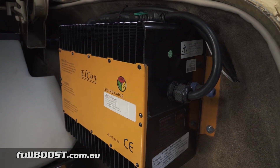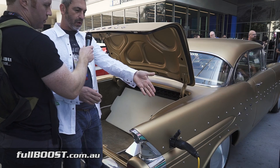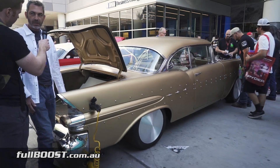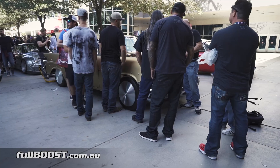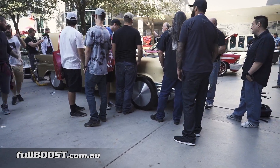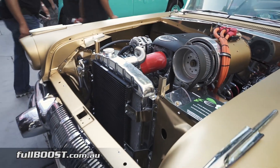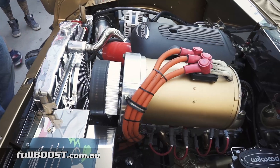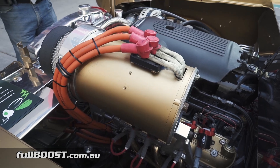This is basically just an inverter and charge system. It allows you to use your industry-standard J1772 charge station port, or you can just plug it into 110 or 240 — it doesn't care how you want to charge it. Most people would charge it overnight at home. Most people don't drive over 80 miles a day, so you go home in the evening, plug it in, and you're getting a real cost savings because electricity is 75 cents equivalent per gallon versus gas and diesel at $3.